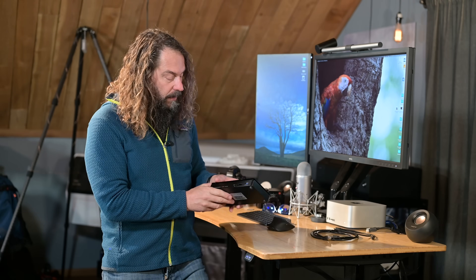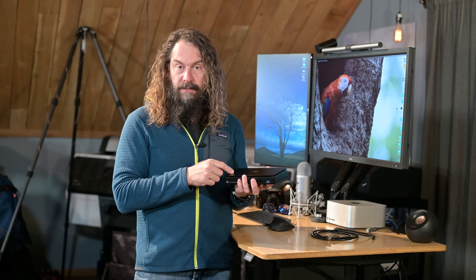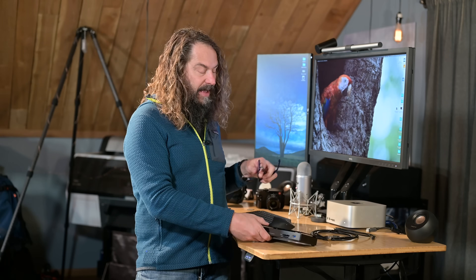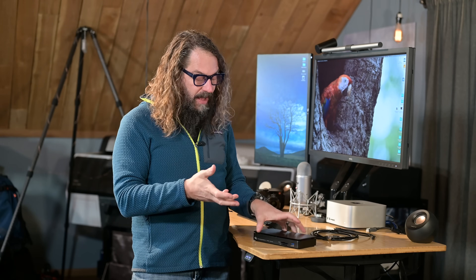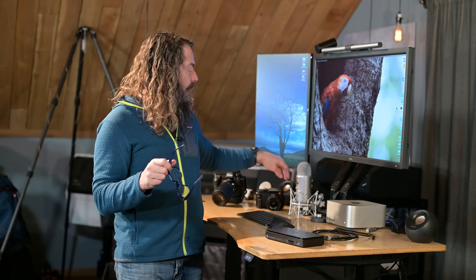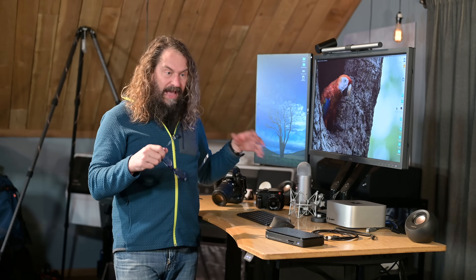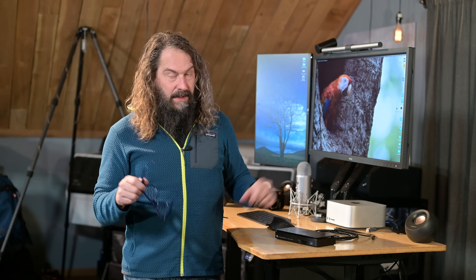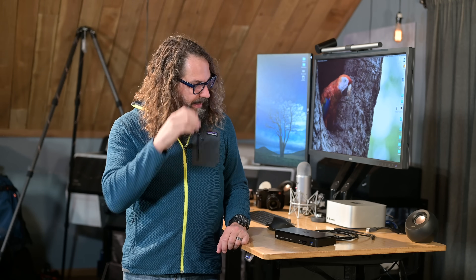On the front of this Thunderbolt dock — and it's fanless. The old version had a fan built in and made a little noise; this one runs cool as can be. I've been running it for about a month with zero problems, no loss of connectivity. I've run a bunch of different Thunderbolt hubs and docks, including a CalDigit Thunderbolt 3 dock that had a few connectivity issues over the years. The CalDigit Thunderbolt 4 dock does not have a CF Express B reader, and it has only 5 gigabit Ethernet — half the networking speed — instead of 10 gigabit. That's 625 megabytes per second instead of 1,250.